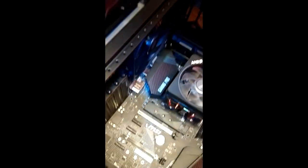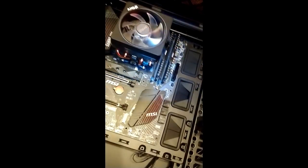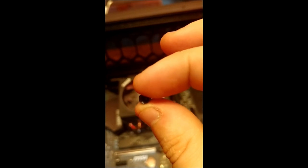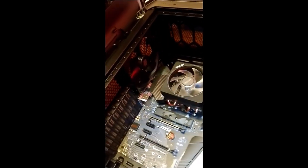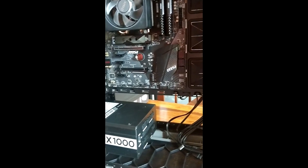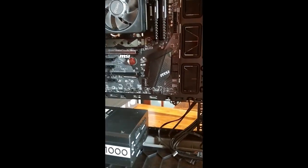That's the motherboard all screwed in. Different cases require different setups — some you can screw it straight in, but this one requires little standoff screws because the motherboard sits off the actual case slightly. You screw those in behind it to give it the raise off the case, then screw it straight in. Easy peasy — make sure it all lines up. Next we'll be putting in the power supply to start hooking up power to the motherboard.